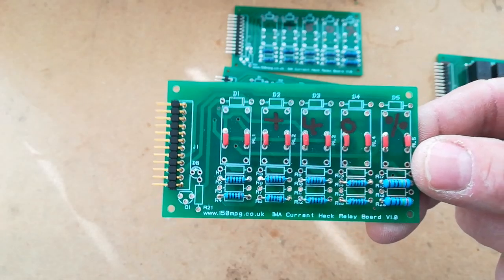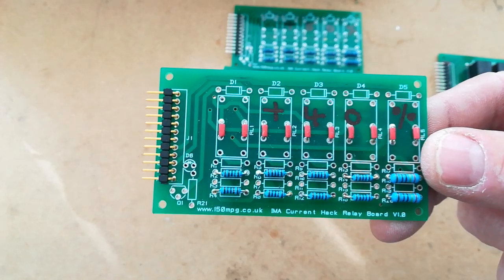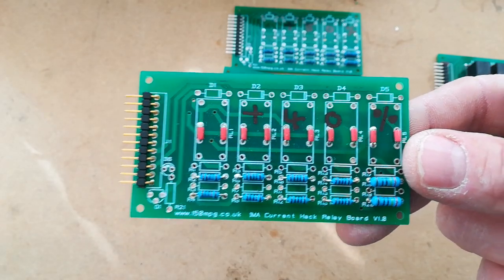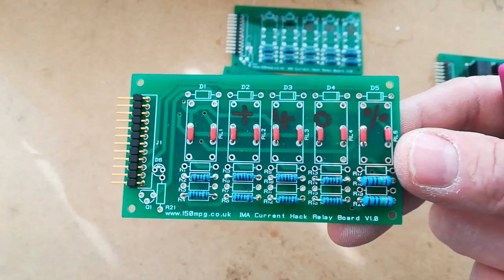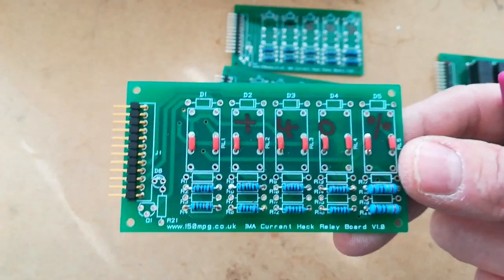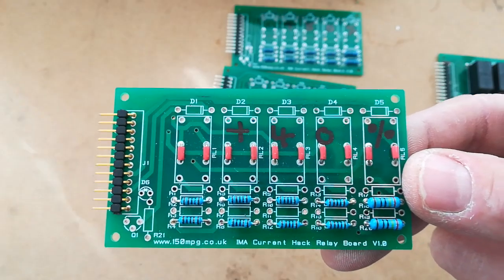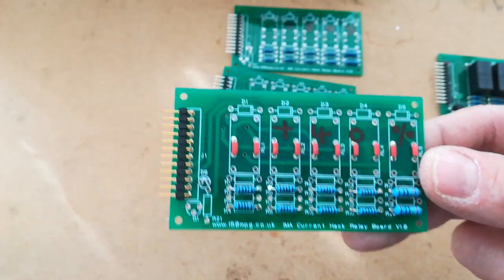So why does it say 40% on it? Well, imagine the current is 100 amps, but we add a 30% reduction to that, so the systems will only see 70 amps. For the car to get back to where it wants to be, to develop the same amount of power, i.e. to think it's providing 100 amps, it has to increase the 70 it's now seeing by a certain percentage. And 30% of 70 does not bring you back up to 100. Just over 40% of 70 brings you back up to 100. So that's the figure I've written on the boards.